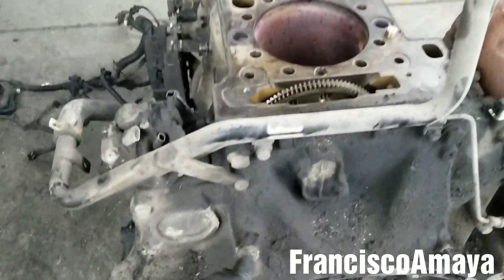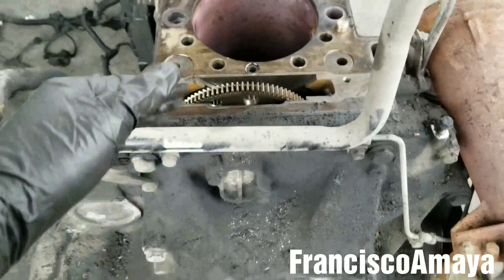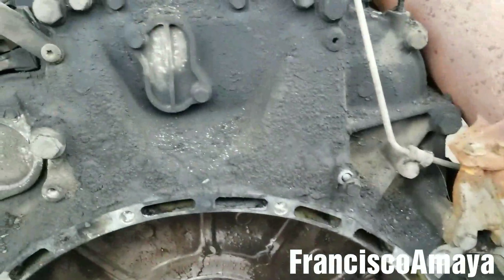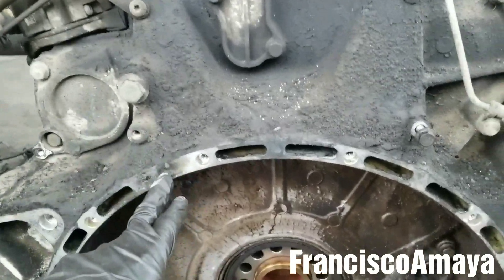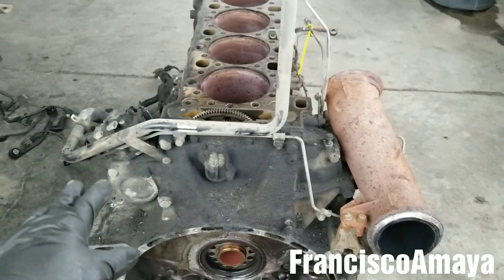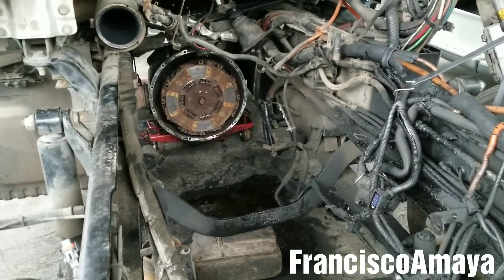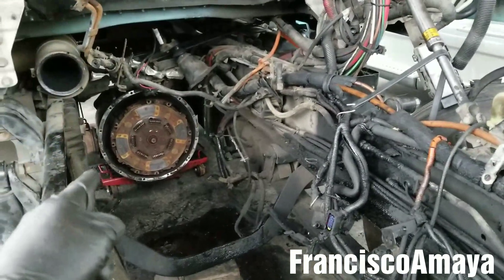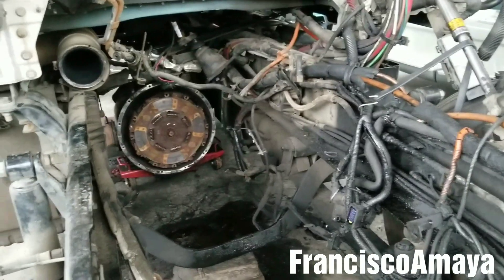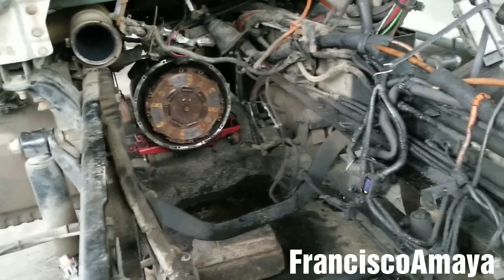If you're just going to remove the gear train cover — in this case the gears are located on the rear area of the engine, which is the area where the flywheel goes. A very important requirement: you have to drop the transmission. There is no other way to remove the rear gear train cover. I have the transmission sitting on a jack because I already removed it. If you want to know how to drop the transmission, you can check my video in the corner or at the end screen of this video.